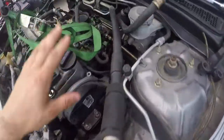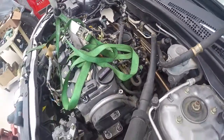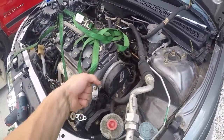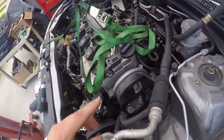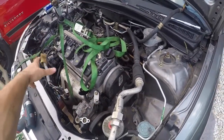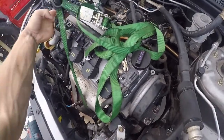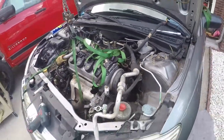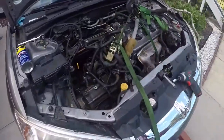And so engine mount, also all the way in the back of the transmission, of course. Gonna make sure you take that off. And the handbrake for the transmission itself that is underneath the car that I showed before. Gotta completely take that out. And now I have held all this wire harness all on top of the transmission and the engine, so make sure it's clearing everything. Now we're gonna try to go ahead and start removing it.